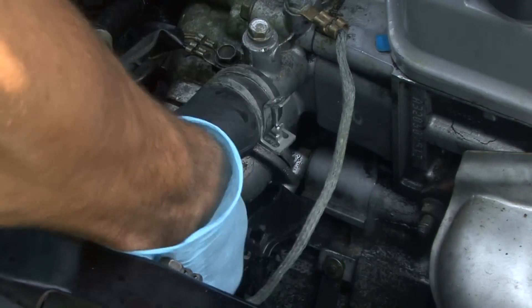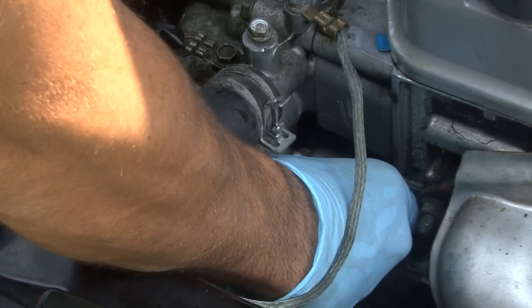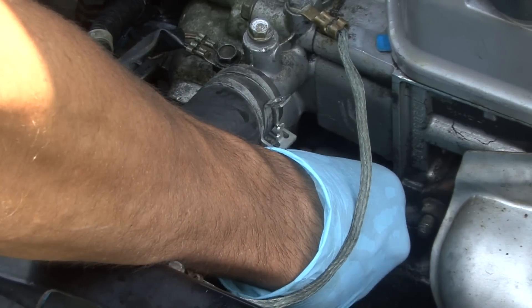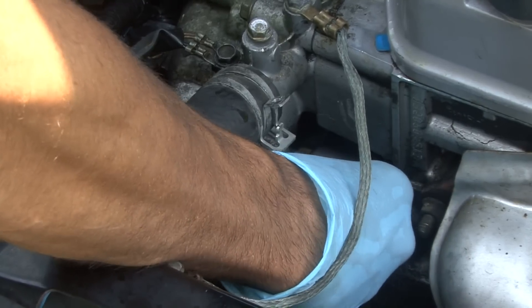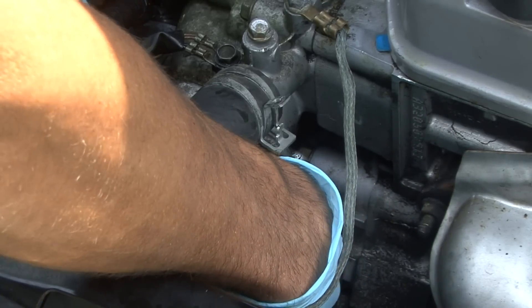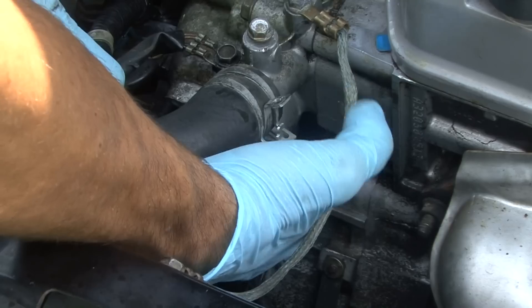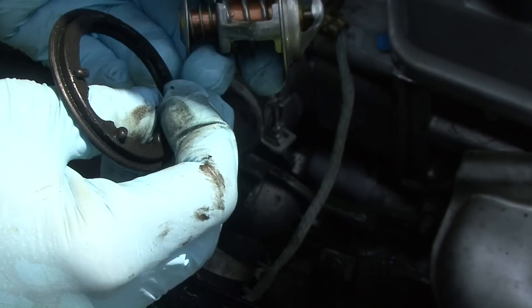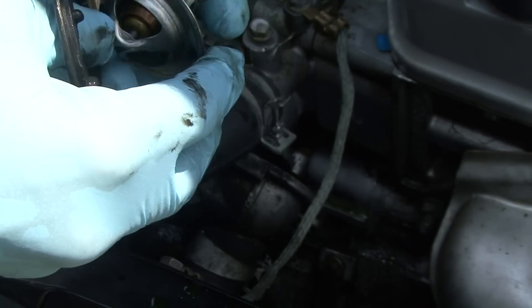It's pretty easy — you just slide it back and pull the thermostat out, then go pick up another 170-degree thermostat. All you have to do is slide it over a little bit, reach up in there, and grab it. These are O-ring style thermostats, so you just take that off and change it out. This one was replaced not too long ago but wasn't working right, so we're going ahead and getting a new one.